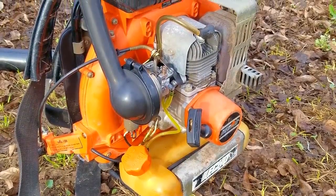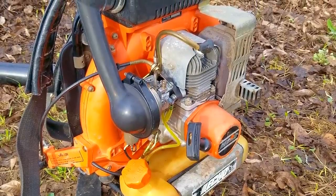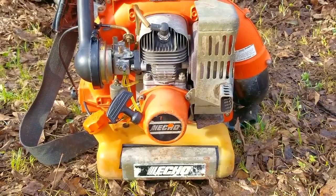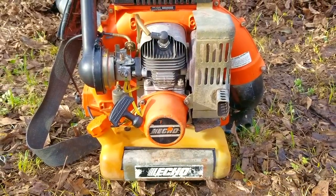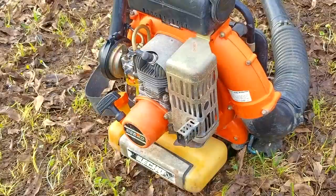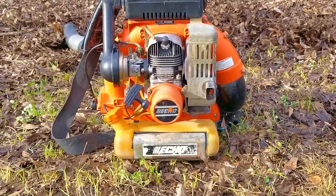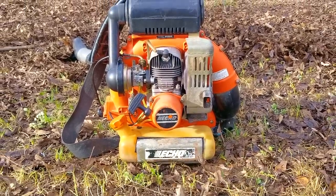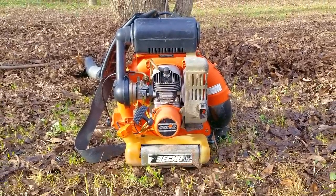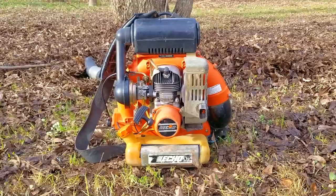So what do I think about this Echo blower? It's nice. For its size, it's not bad at all. The only complaint is the weight — it feels like I've got a large battery strapped to my back, but it's better than some of the toys I've used before. I'm most impressed by the build quality, though. I wish more blowers were built like this, but with the cost of materials, labor, and corporate greed, it would be priced out of the range of most homeowners. In the end, it was the carb, and when trying to save money on parts, you're going to pay for it with your time. Would you have just bought the carb in the first place once it didn't start after servicing it, or would you have kept at it like I did and saved a couple of bucks? Thank you for watching — please feel free to ask me any questions about this project or your own projects, and I hope to see you in the next video.